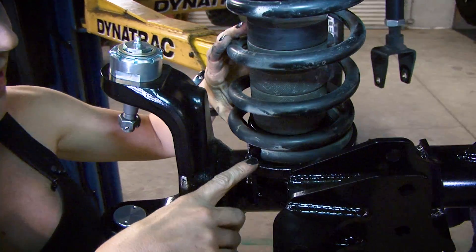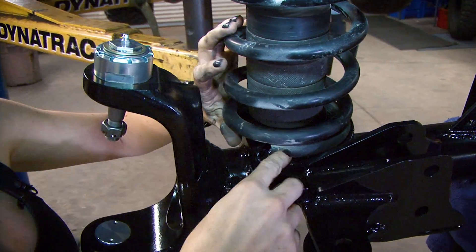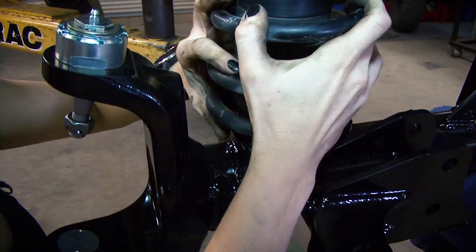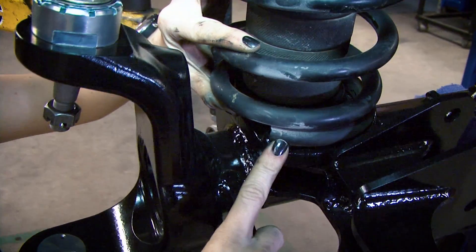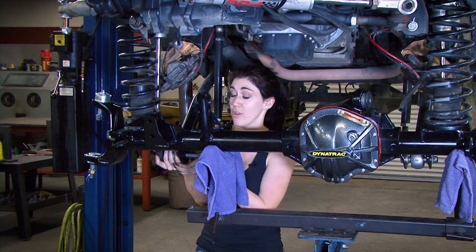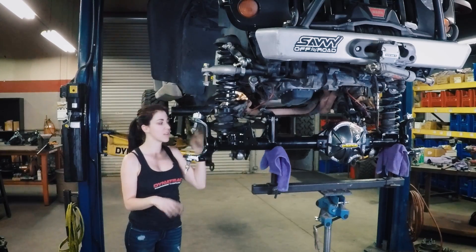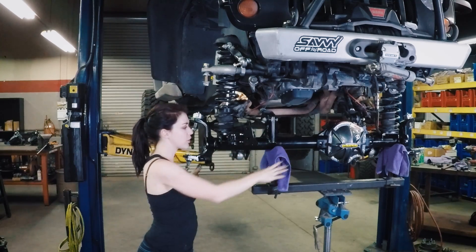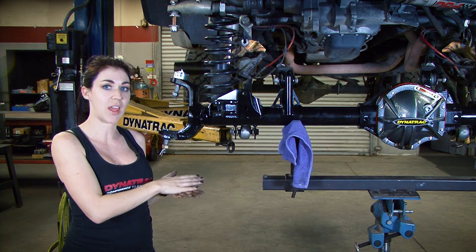This cast helical coil seat is great — turn it and make sure that the end of your coil is seated properly. Now you can go ahead and put the bolts in the last three control arms and attach the shocks. Tech tip: do not tighten any of your control arms until you are down on the ground at ride height.